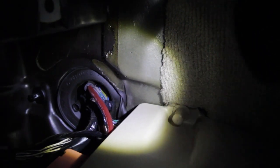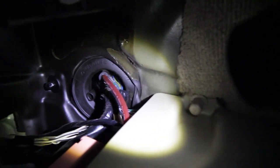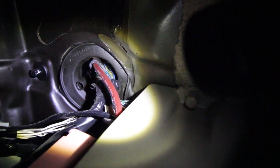First things first, we're going to look under where your foot is to see what area is available to drill a hole through the firewall. For me, I'm going to look for where my old wire used to be to give you a reference on where a safe spot to drill is. With my Lexus, we shared it with the ECU hole — it's a rubber boot with the ECU wiring and we just shared the boot, drilled a hole in the boot basically and snuck the power wire through. Then it'll go through the panels all along the side, through the back seat, and then to the trunk. Let's go ahead and get this new wire in and take this old red one out.